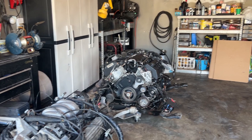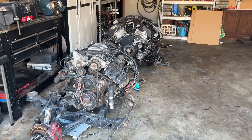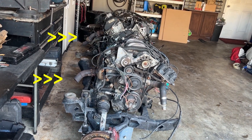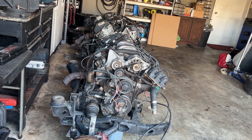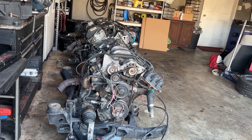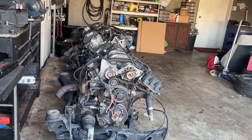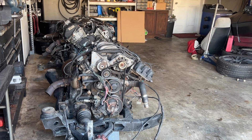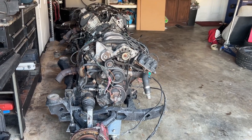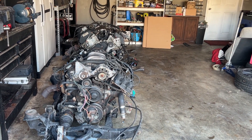Another thing we're going to have to really work on — you can see where the exhaust comes out. Actually, if you see the exhaust coming out the back, they look fairly the same. So maybe we'll get lucky and we won't have to cut the trunk. I'd like to keep the flex pipe because the engine obviously rocks back and forth under acceleration and deceleration, so we have to have some sort of flex pipe, and that factory one looks pretty good if we can keep it.